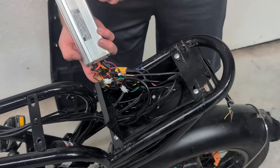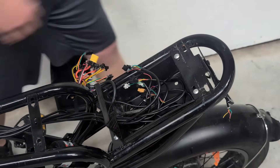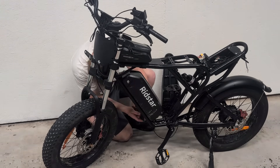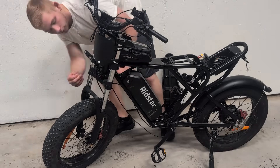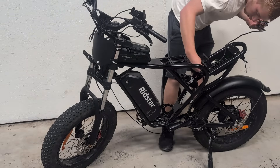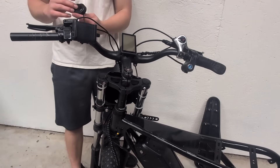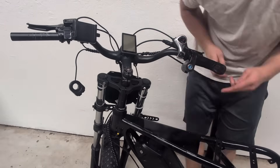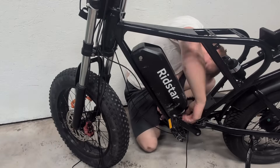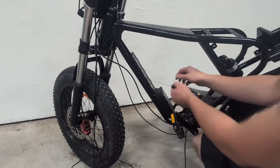The first step is to get the broken controller out of here - it should be pretty fast, just have to unplug everything and throw it out. I'm chasing all the wires down and we're going to be stripping this frame completely, getting it ready for the 60 volt battery, motor, controller, and everything else. I also have to take off the controls, grips, and ignition - basically everything on the handlebars, including a phone holder. Now we're moving on to the battery, which should come off pretty easily - there are just three screws to remove.